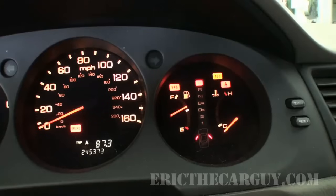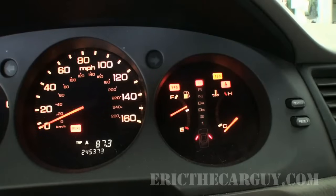Not wanting to lead you astray — not all ABS codes will flash the light on the dash. Similar to OBD0 Hondas where you have a flashing LED on the computer, there's a similar setup on many ABS systems on older Hondas and Acuras — older Accords, older Integras, things like that. There may be an inspection window in the back seat area that you need to pop open and look for a flashing LED. You'll have to look up that specific location for your application.